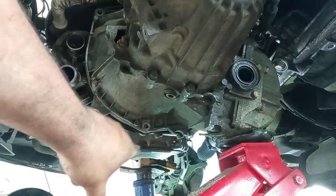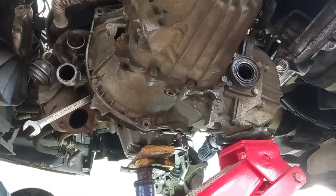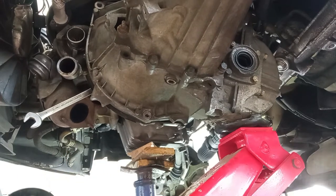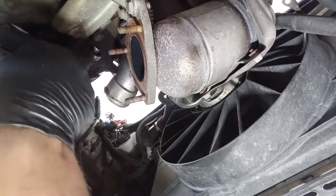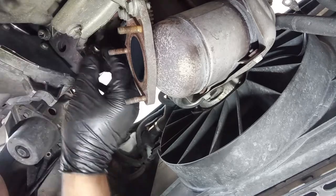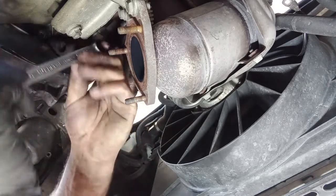Okay, now I know how much room I have there. So this is low enough, okay? I have to use something to put in there. Really nice. Last nut to go. So we have two long bolts on top. We have two nuts in the middle of the gearbox. And we have two 15mm head ones here on the bottom side on the oil sump. Just remove all this, 2+2+2, and everything is good.